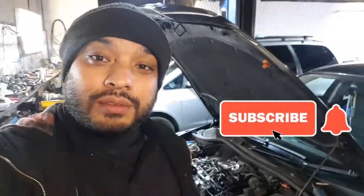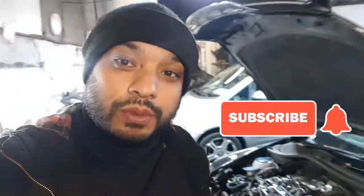What is happening guys, it's Raoul TV, Team Raoul, your favourite YouTube mechanic and we're back again. This time round, for the Skoda owners out there, we've got a 2012 Skoda Octavia 1.6 diesel TDI. I'm going to go ahead and replace the slave cylinder — I can see it leaking. If that doesn't fix it, then we'll replace the master cylinder, but first things first, let's change the slave cylinder.